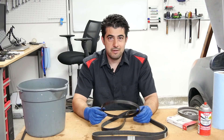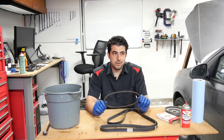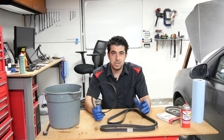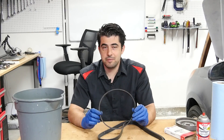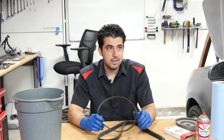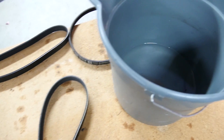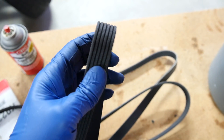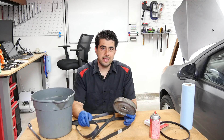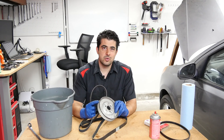All those engineers at the drive belt manufacturing companies couldn't figure out rubber protectant? What I would do is have exactly two of the same belts, sell one for 10 bucks, dip the other in rubber protectant, offer it with a lifetime warranty, and sell it for 20 bucks. You'd probably triple your profit per belt. Also, every time you spray belt conditioner or put your drive belts into rubber protectant, you make it a little tacky — which stops the slipping — but you also run the risk of swelling the ribbed surface of your belts. And when that happens, especially after the belt conditioner wears out, the belt grips the grooves inside your pulleys more, and they wear out even faster.